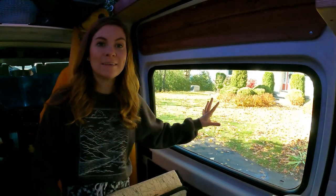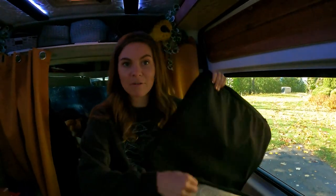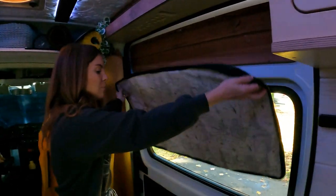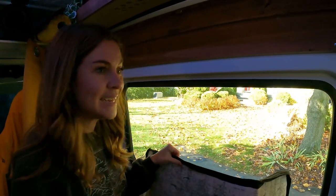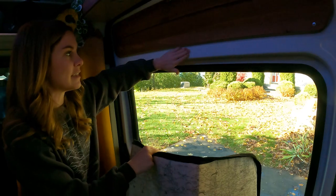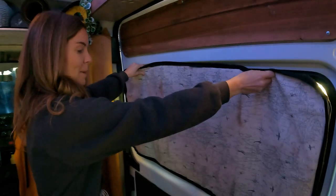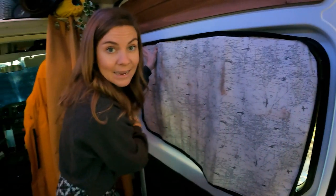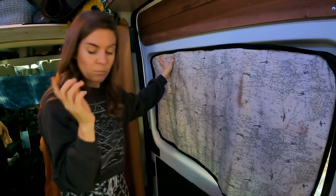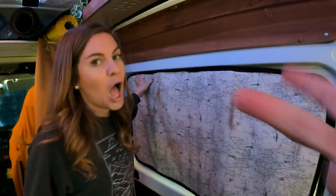This side window is obviously the biggest space in the back where we're going to be letting in light, and we have the biggest window cover for it. The problem I ran into again was thinking that the black material was metallic — it's aluminum and it is not magnetic. The only magnetic part is the actual frame of the van. This time around I need to make this piece bigger so that it fits around the whole metal outside frame.